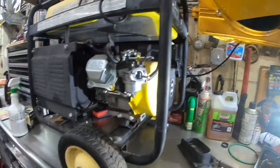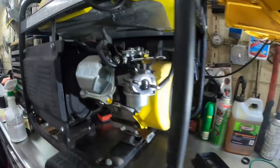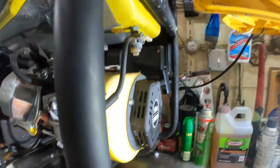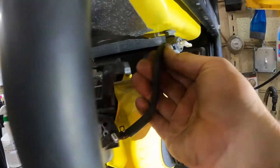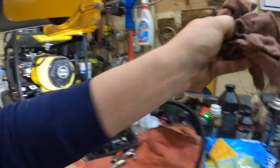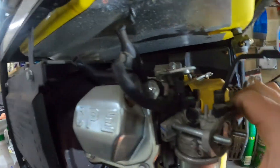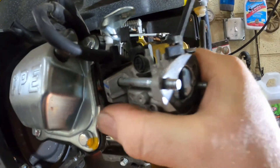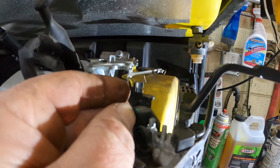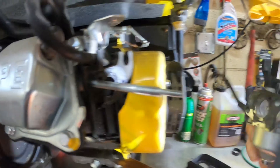Now we can get a pair of needle nose pliers and push on that, and reach in here to disconnect the spring. The rod is not going to come out until we take the carburetor off. We also need to take the fuel line off at one end. The fuel line is off — a little bit of gas, but the gas is pretty good. Now we need to rock the carburetor back and forth on its mounts. As you pull the carburetor out, it pulls on the linkage, so the linkage rod will pull right out.